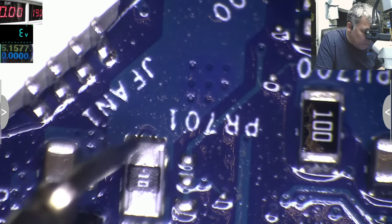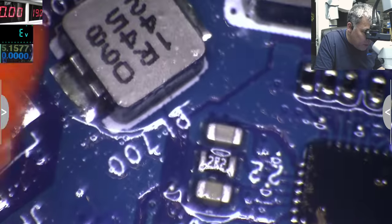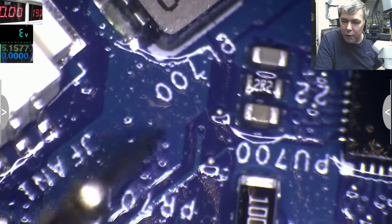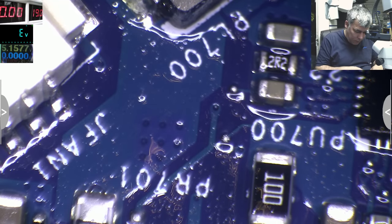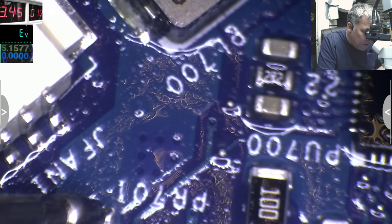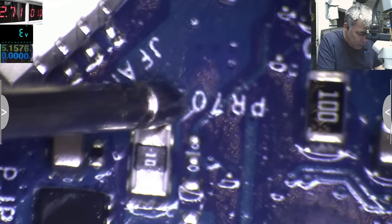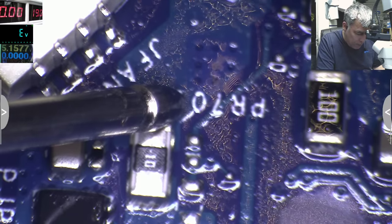Okay. And after the current sensor, you remember I told you we have the main 19 volts power rail. For some reason it's going to this coil, so probably here it's a power supply, but this is the point where it's going everywhere on the laptop, yeah? So it'll come with 19 volts exactly there. Here. And now we can search for whatever is getting hot. Taking 3.4 amps.